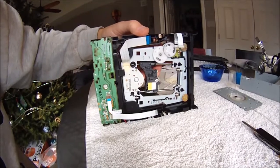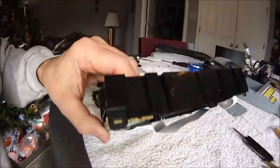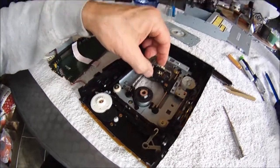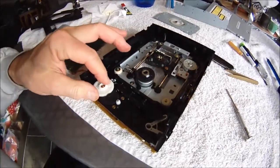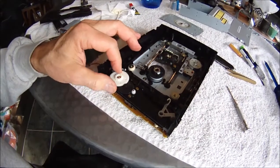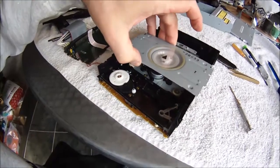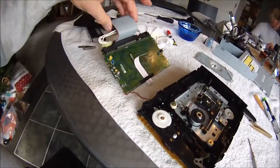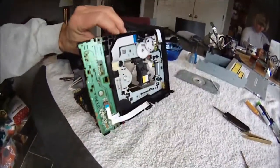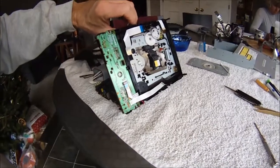This is what it looks like with the tray mounted in there. It's this screw and washer and this screw and washer that fit over the rubber bushings. On the other side, it's these smaller ones that fit over this set of bushings. This is the reader — slides back and forth — and the whole thing moves up and down when the motor actuates, which is what causes it to pull out of the way when ejecting. When it's running, it is in the up position. Then the top goes on here that locks the CD in. We still have these ribbon connectors to put back on to the sliding reader tray and the computer board that goes on the other side. The ribbons just slide into the little fittings.